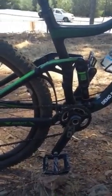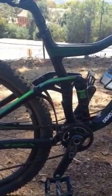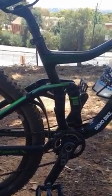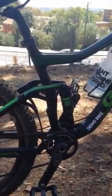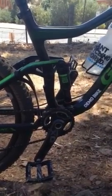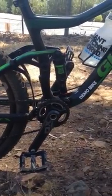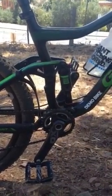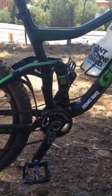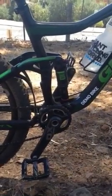Only thing I'd change is probably go a shorter crank. These are 175mm cranks and it just seems like it's a really low bottom bracket. When you've got it sitting that deep in your sag it's very easy to clip pedals - I was clipping pedals here and there, nothing major, but it may be an annoyance. I've got short legs so the 170s suit me better. I had the same problem on the Norco Range and the Giant Reign 2015 - cranks are a bit long for me. But I guess it's a personal preference and how you set the bike up around it.